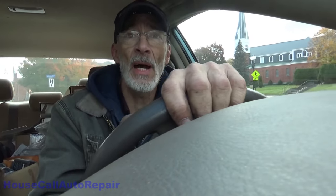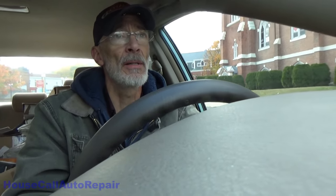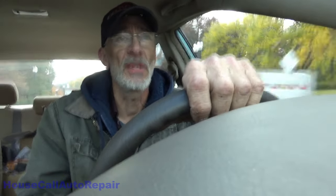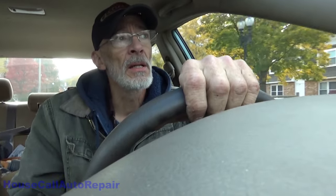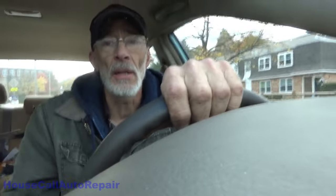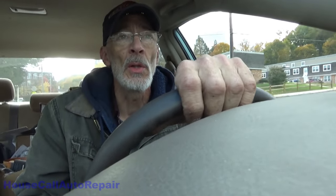Sorry I couldn't get you guys a better repair. The 2018 Silverado was more or less suffering from a bad connection at the starter. Signal wire was intermittent. And that's most likely due to the dealership, during one of the previous two warranty replacement starters, having broken the lock that holds the signal wire on.